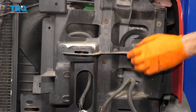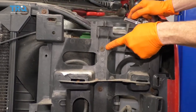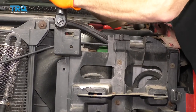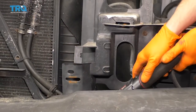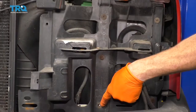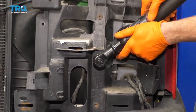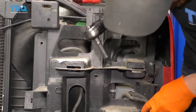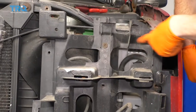Now, the next thing we're going to need to do to get this off of here is, of course, to remove all the mounting bolts. You're going to notice there are several — there's going to be some 10-millimeter bolts, and there's also going to be some T25 bolts. There's going to be one straight down and under here. There should be one right here — this one's broken. Another one there, another one. That leads us to the T25 Torx bits.